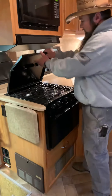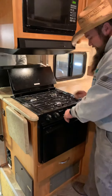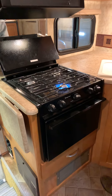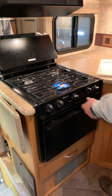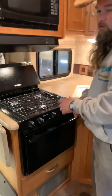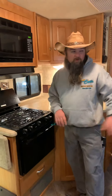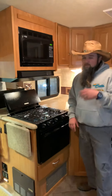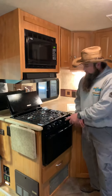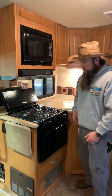Your stove works just like a grill outside — put it to light and it's direct spark ignition. The tip is: if it's been sitting for a while, light your stove before trying any other propane appliances, because other appliances only try to light three times before going into safe mode. Lighting the stove first spends up to five minutes bleeding the air out of the propane line.